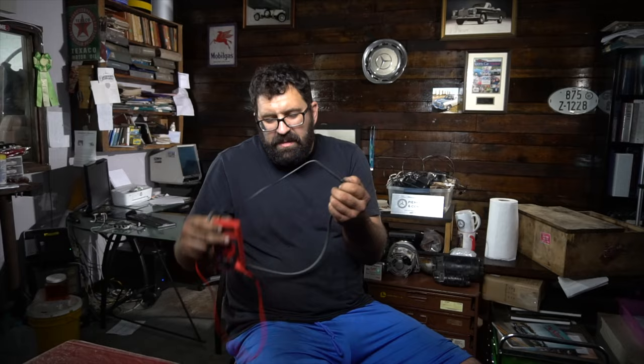If you can identify a bad wire and/or resistor in your plug loom, it means you can identify which wire is bad and save the rest. Some people might use the logic that if one fails, the rest are going to fail soon — not always. This doesn't necessarily mean the other five, six, or seven wires are on their way out. It may just mean that the two or three weakest ones in the set need to be replaced. The nice thing is you can actually disassemble the wires, slide it out of the heat insulation sheath, and replace just the wire or just the plug resistor without having to compromise the originality of the car.